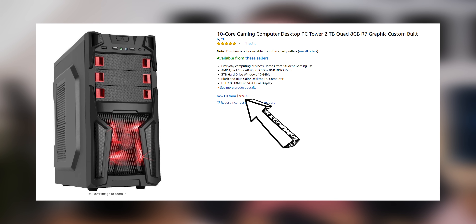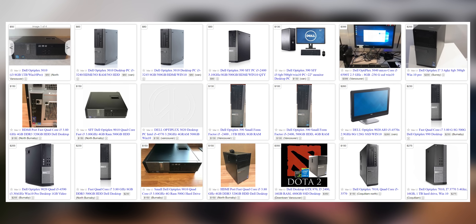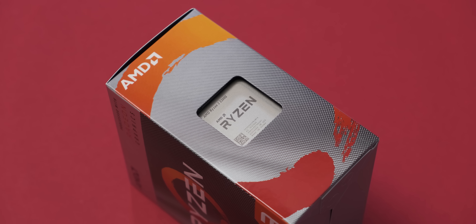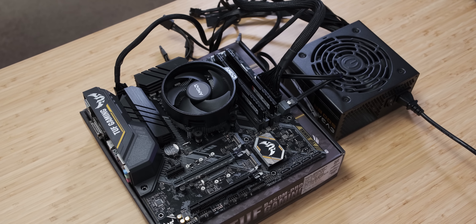Before we get into the specs list, because we have a $390 budget there are a bunch of ways you can go about speccing up this PC. You could go the maximized performance short-term route but sacrifice on motherboard quality, power supply quality, and maybe even RAM amount. Or you could go the knife-battle-people-on-Craigslist-for-a-second-hand-Dell-Optiplex route — drop a graphics card in and get great gaming performance, though you sacrifice future upgradability. Then there's the more boring AMD APU route, spending more money on a better power supply, better motherboard, and maybe 16 gigs of RAM, which sacrifices short-term performance but gives you a nice base system to scale over time.